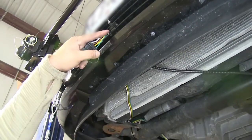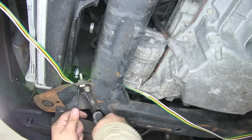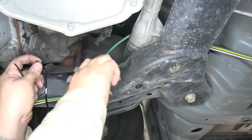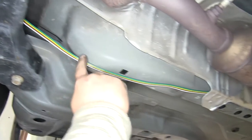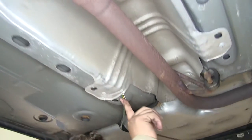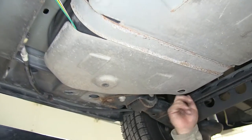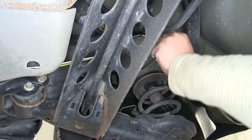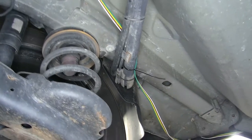We've got our end zip tied to the front here. We ran it through our bumper, came back over here, and zip tied it to our subframe bracket. Then we ran it along the bottom side of our subframe and zip tied it down. We ran it up and over our steering, underneath our heat shield, and tucked it up behind it so the heat isn't going to affect it. We came over to our gas tank shield, tucked it underneath, and came out the back side. Then we've got our fuel pump motor here with some wiring — we zip tied to the harness, came up and over our gas tank inlet, and zip tied to that.